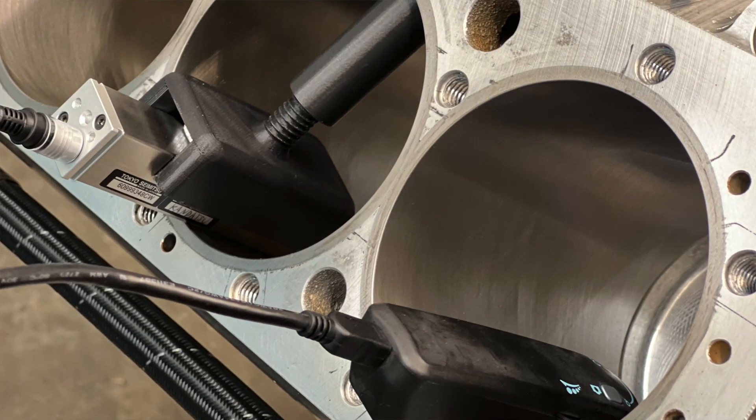We did a video with Greg Anderson where he honed a block with a roller hone — the biggest thing there was using diamonds all the way to size, then switching over to CBN and counting strokes. Bob is basically doing the same thing here: diamonds for roughing all the way to size, within a couple of tenths, then a finishing diamond — a much smoother abrasive — to create that plateau. You check for the correct plateau finish with the profilometer every time, in four corners, no matter how many times it takes. And Bob uses the Performance Trim software to do it.